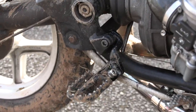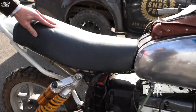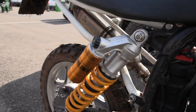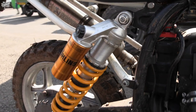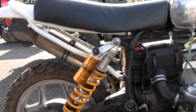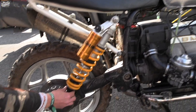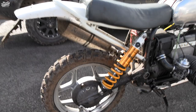I've got what I think is a Cagiva seat that I've made fit, with a whole custom subframe. Titanium bolts here. The shock is off of a BMW 450 enduro bike, which I also sourced — it's working really nice. We can dial it in: a few clicks softer, a few clicks harder, and we've got rebound adjustment down here, which is really nice. It just keeps that wheel tractable.